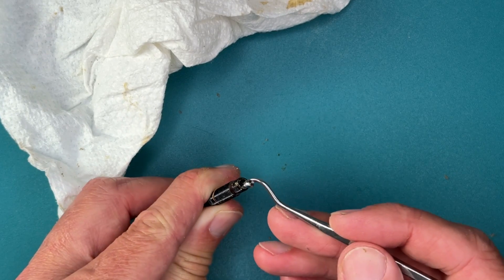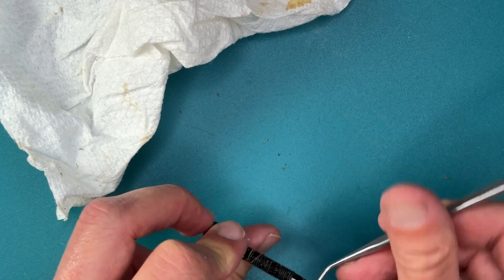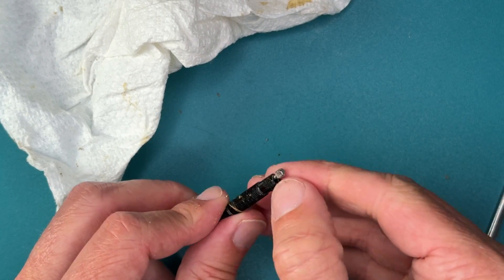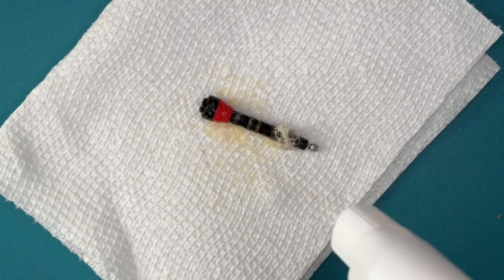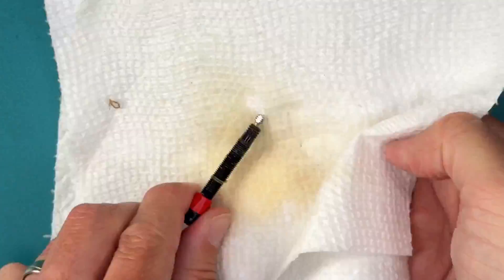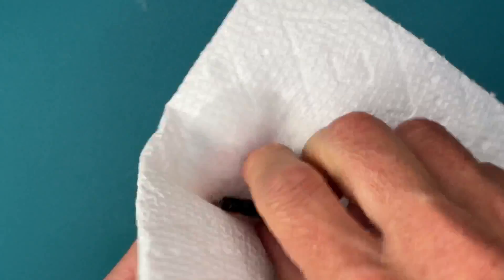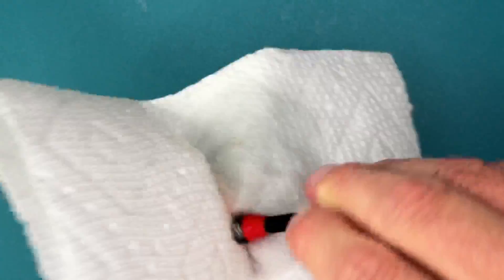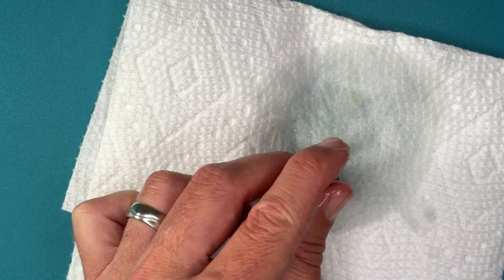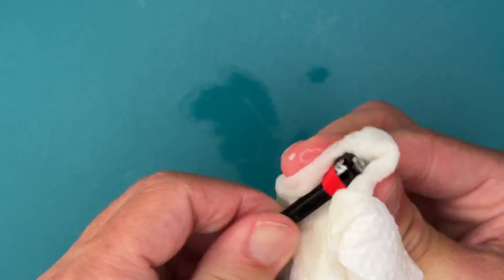It may take more cycles of spray and drying to know for sure. Aside from the O-ring on the poppet and the red seal for the rim, the valves are all metal, so cleaning should be a breeze. A little citrus degreaser and some isopropyl alcohol and they look good as new. I'd hope to get through the center of the core with a pipe cleaner or something, but the opening just isn't wide enough — hopefully that won't be necessary.